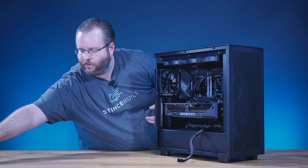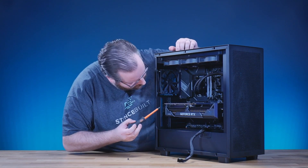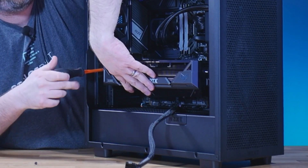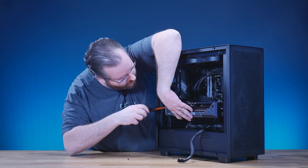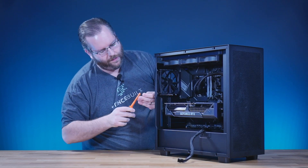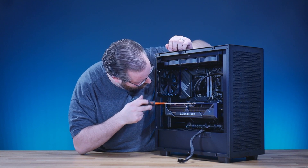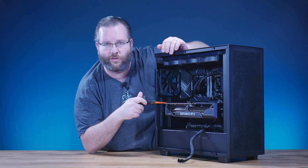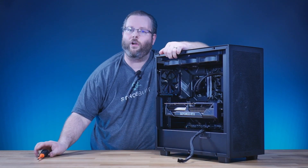Now we're going to get to the two screws that are on your slots. We're going to grab them and make sure we put these in. When you start screwing in your card, make sure to give a little extra pressure on the top of the card, because the card is going to naturally sag with the weight. So push up slightly on the card to give it extra support and screw the screws in the back nice and firm. Some cards will have two or three PCI slot covers removed for the graphics card — make sure you get all those screws in properly.